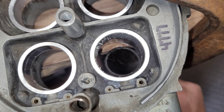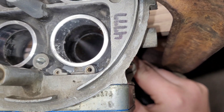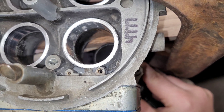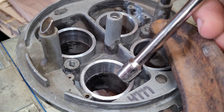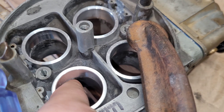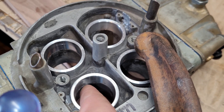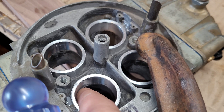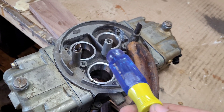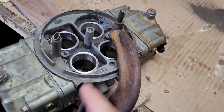Yes, it does. You could see there was some turbulence going on here. Not only that, but we do have seepage between the actual carburetor and the insert itself — we do not have any sort of sealant or gasket. That's okay for this test because we are merely testing if having the location right there will allow it to pull from the bowl — which it does, clearly. All we have to do now is just optimize that.